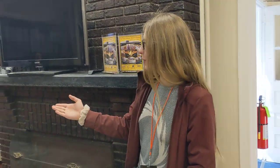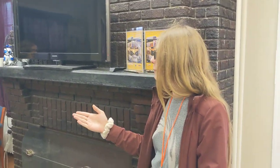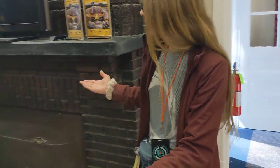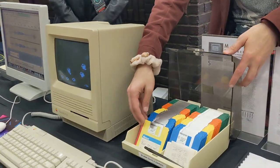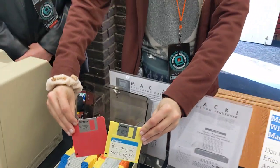Because, as Dan mentioned earlier, and this is where we would come back to, one of the limitations of this computer is its ability to write diskettes. The Macintosh Plus can only write to an 800 kilobyte floppy disk. Okay. This is a bit of a challenge. For those of you that remember, the early DOS 3.5-inch floppy disks were 720 kilobyte floppy disks. The Macintosh gets an extra 80 kilobytes of storage out of the same disk because it uses a different hardware algorithm, not a software algorithm.